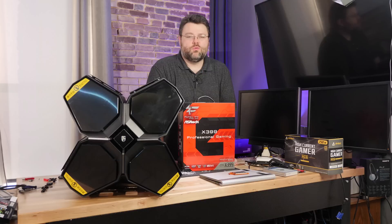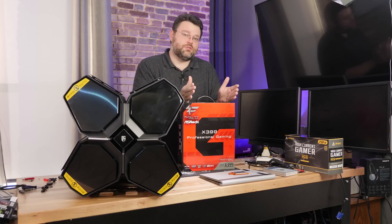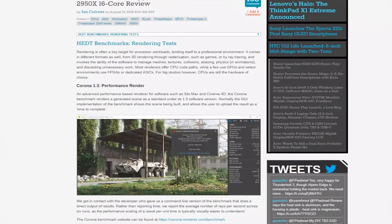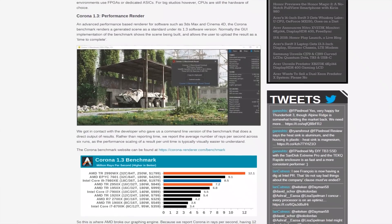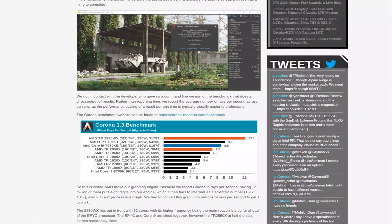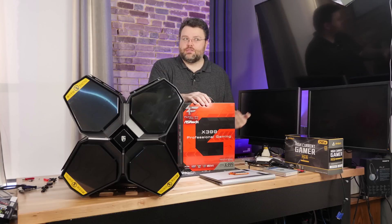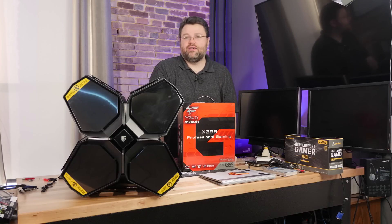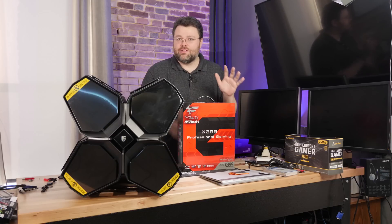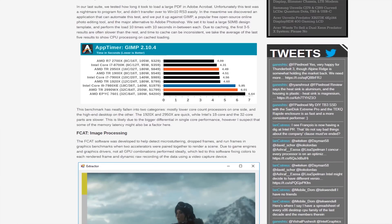Since I didn't get the CPU early I could do my own benchmarks - let's talk about the top two benchmark sources in my mind. That's Ian Cutress's stuff from AnandTech; his benchmarking automation skills are second to none. I've tried to replicate some of that automation and it turns out that's fairly pesky to do even with AutoHotKey. The Linux-side tooling is more repeatable, whereas with AutoHotKey, scripts, and PowerShell it's not nearly as repeatable. Looking at the benchmarks on AnandTech showing that the 2990 will sometimes regress compared to the 2950, I think we can fix that - mostly on Windows.